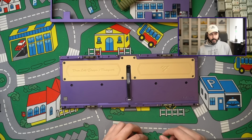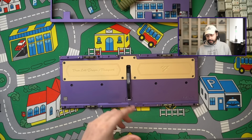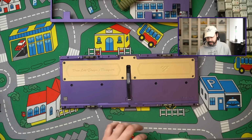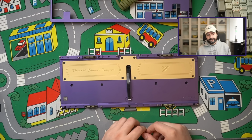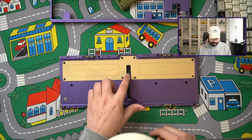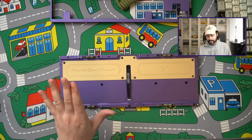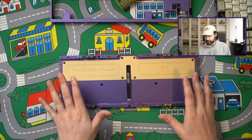All right, on our bottom, we have a battery cover. By default, you will get an aluminum battery cover. This is equivalent to basically just having a full aluminum bottom, which if you've ever typed on a TKL, you know that's not really the best sounding thing in the world. Also, on the base model, underneath the battery cover are 2 pieces of foam instead of batteries, assuming you don't get a wireless version that requires batteries. You can upgrade to a steel battery cover, which I would personally not recommend, or you can upgrade to a brass battery cover, which is a little more expensive, okay?